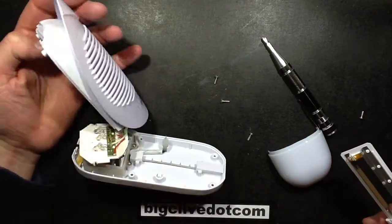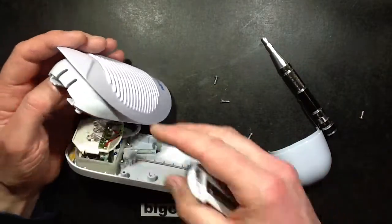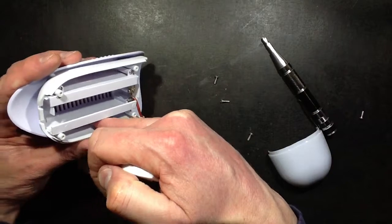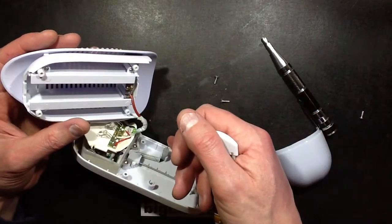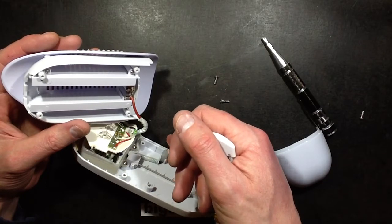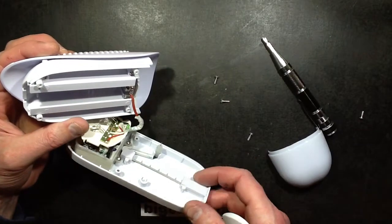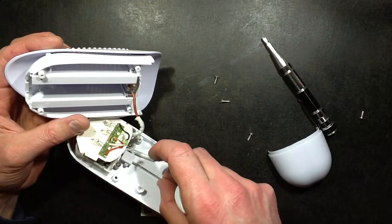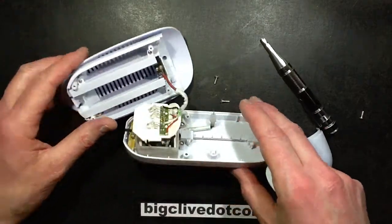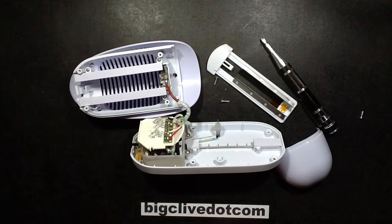Another thing I didn't realise is that the air comes in at the sides — there's no vent in the back. The air comes in at the sides, comes down these ports here, and then gets blown out the front. That ioniser needle isn't really going to have airflow in that direction. I wonder if it does create ions — I might give that a wee test later on. But anyway, that's it. It's interesting enough, and it works okay, creating that sort of fresh ozone-y smell out the front and quite a modest airflow.